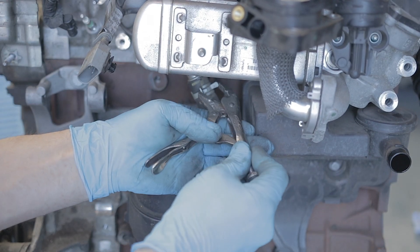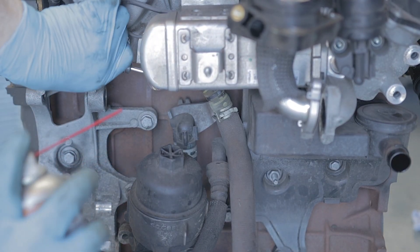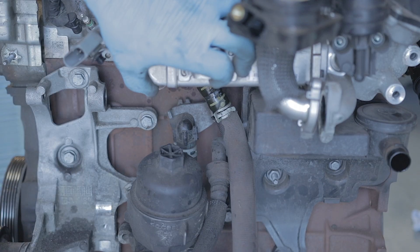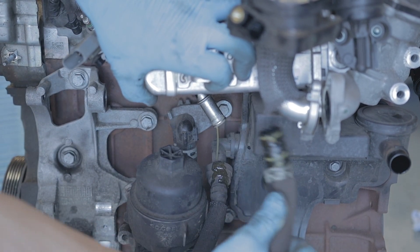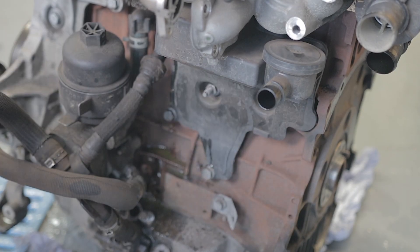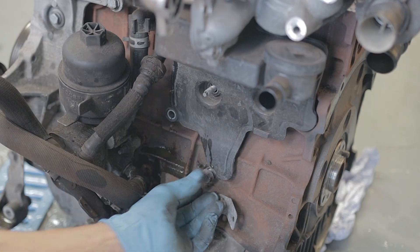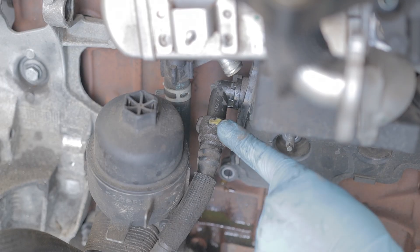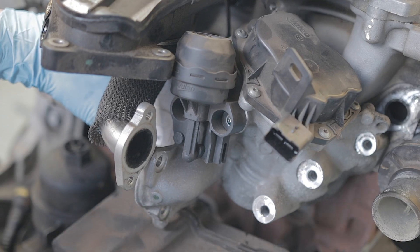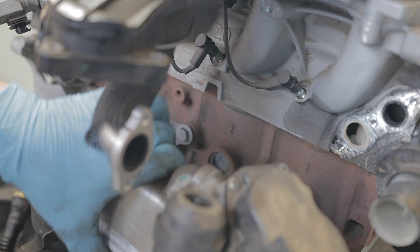There's a cooling hose connected to the bottom of the EGR valve. It would probably be a good idea to remove that hose - if you can get a screwdriver into the hose a little bit and squirt some freeing oil in there, that'll help it come off, because the hose can tend to get stuck to the pipe and become a right pain. Even if you bend the pipe up and wriggle it, it still won't want to come out. You've also got your crankcase breather assembly here - three 13mms and one 10mm. Unbolt all of them; there's a pipe coming off the breather system, press the yellow tab in and it should pull out. Pull your breather assembly out, remembering there's a pipe going into the engine you'll have to pull out carefully so you don't break it. Then you can lower your entire EGR off the engine.